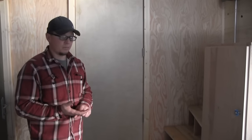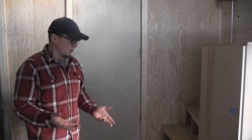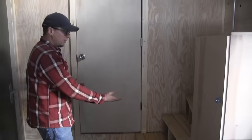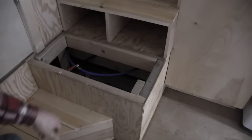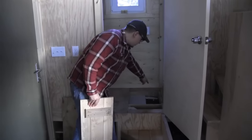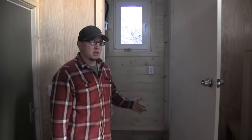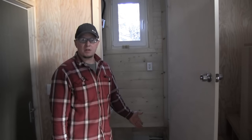We live in extreme temperatures where it gets really cold, so how do you protect your plumbing from freezing? In a typical RV they just put everything underneath, but here in Alaska we had to figure out how to keep everything from freezing. So we raised the bathroom floor and built on it to hide all the plumbing. There's a removable hatch with the water pump, a gray water tank back in here, and another hatch in the bathroom that has a fresh water tank, a water filter, and a pull valve to drain the gray water tank — so everything's accessible. The spray insulation on the walls and floor should keep everything from freezing in cold temperatures.